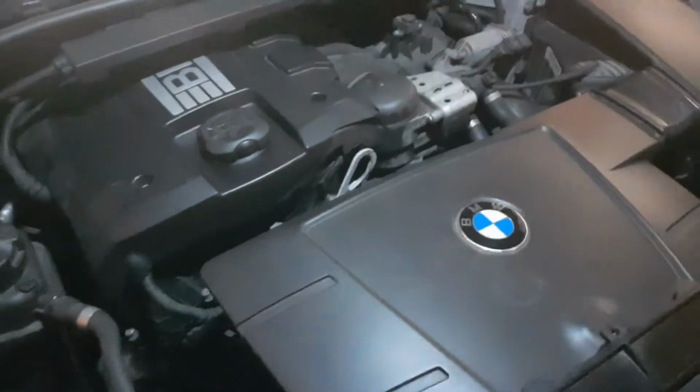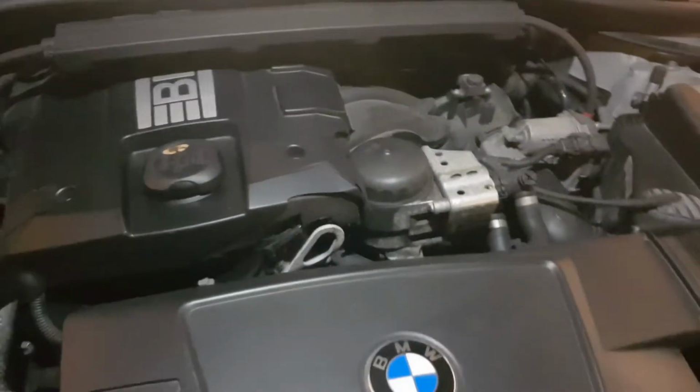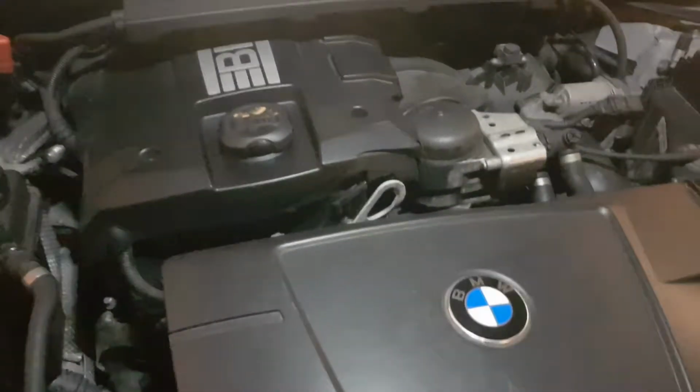And underneath the car, I'm going to be opening that little hatch back there. I'll show it in closer detail, and draining the oil out of it, and then changing it. This car takes 4.25 litres of oil. It's not that much oil, and the job's not difficult. It's just take this out, replace the oil filter, drain the bit underneath, top it up again, and that's it, done.